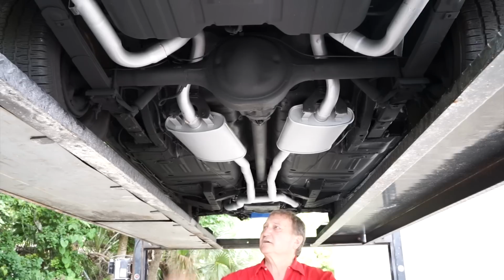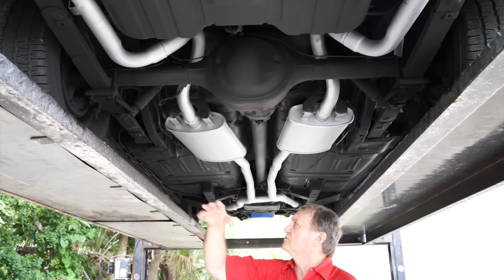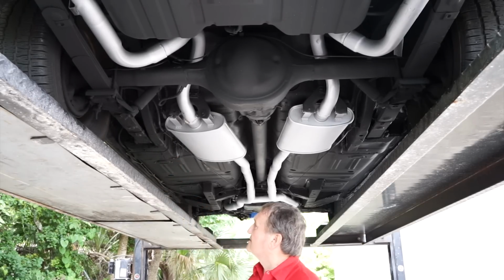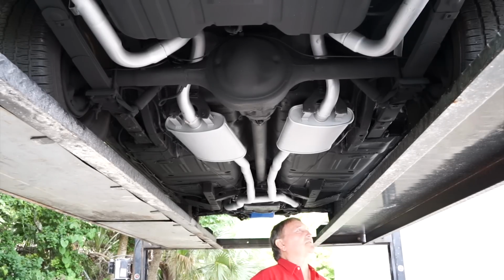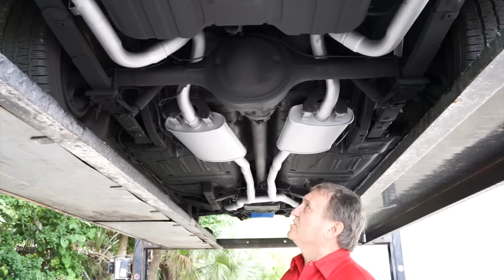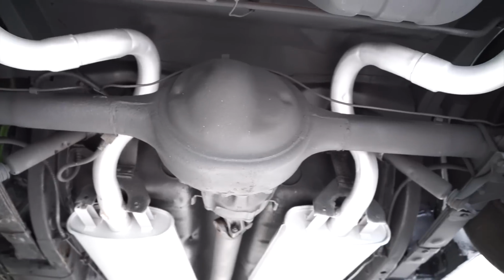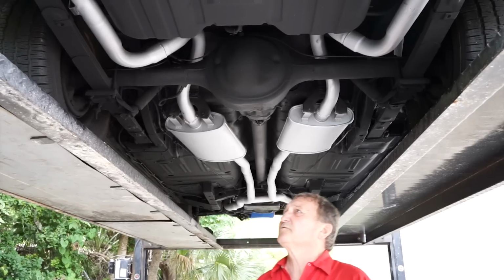Multi-leaf rear spring suspension on it, and the springs have a nice curvature to them yet. The torque boxes where they mount to the front and attach to the sides of the subframes are nice and totally distortion free, and no rust or deterioration whatsoever. The pipes coming out again are 2 1/8 inch, going into the squashed oval type stainless steel exhaust that exit out through your little windows in the rear valance, the way these cars work from the factory.